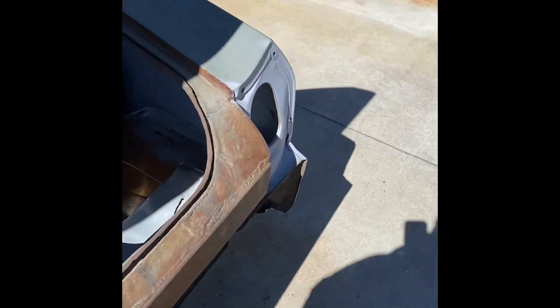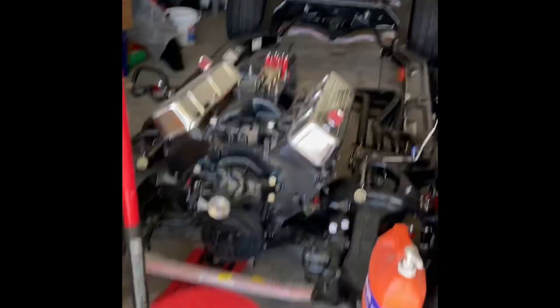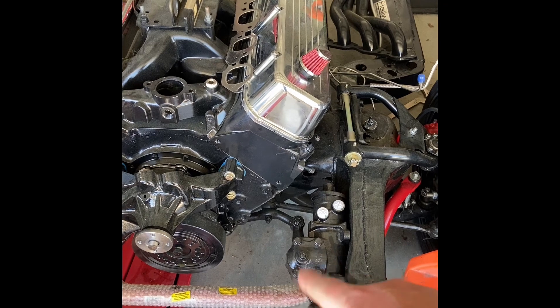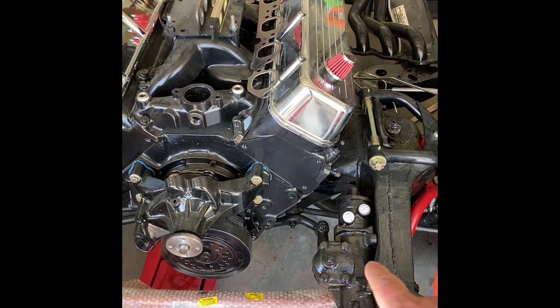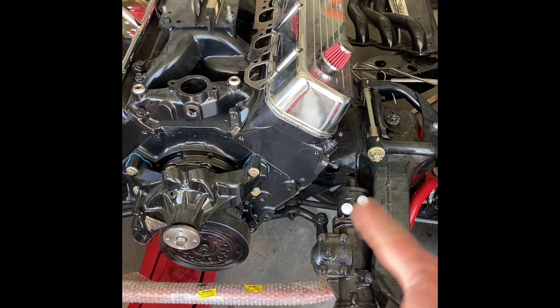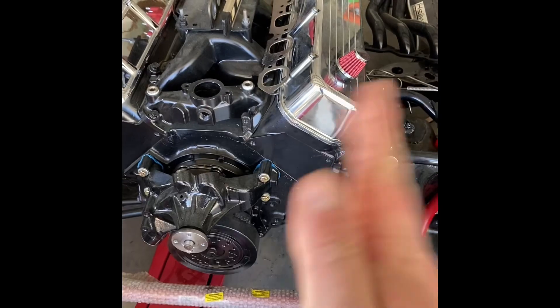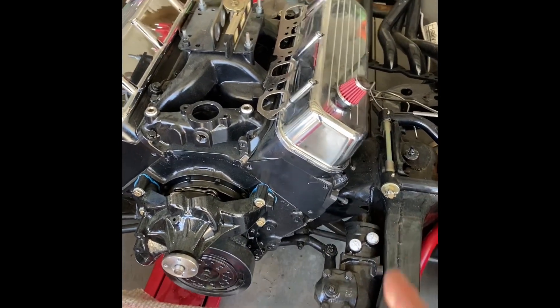I did manage to give you an update on the chassis. I realized that I haven't really done much to it because it's pretty much done. I did put a quick-turn gearbox in it — one of those quick-turn, I think it's 12-to-1 or something gearboxes — to give you that attack on the steering where the wheel doesn't take so many turns to get a full lock-out on both ways. So it'll have really good handling.